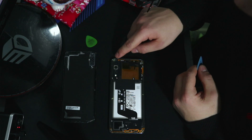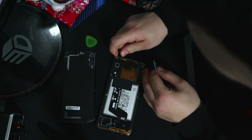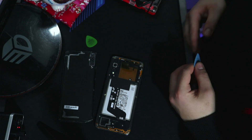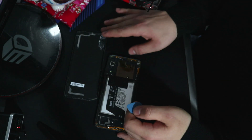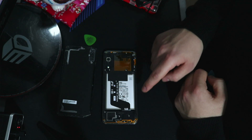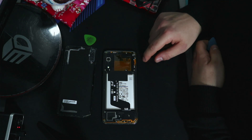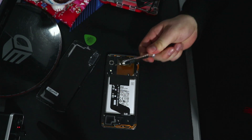Since this has been opened once before I had a little more aggression, but the previous guys did a really bad job — they applied some horrible gunk, actually on top of a screw so I can't get access in there. There's gunk in the corner and in the middle. There are a total of 14 screws — bear that in mind. My plan is to take all the screws out, then take the plastic housing out, which will give me access to the bottom. But before any of that, it's a definite must to take the SIM card out — you do not want to be prying housing open with the SIM card in because you will break the SIM card tray.